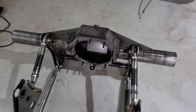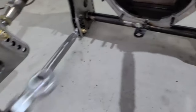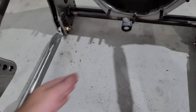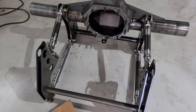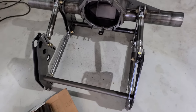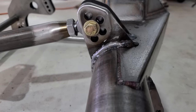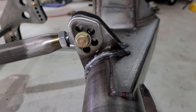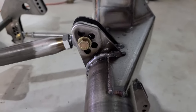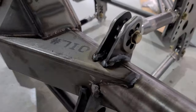How I've done the diff: I've welded the arms on. The way I've set it up for the wishbone is I'm going to have it under here, and the wishbone is basically going to triangulate — it's like a triangle section coming in here, that's going to support the housing from moving side to side. I won't be able to do that until I get it all mounted up in the car. I've only just MIG welded the four link brackets on the diff because I don't know how to TIG weld, and I don't really have the time to learn it. So I'm just going to stick with the MIG, and if I get any ugly welds I'll just grind them — as long as they penetrate and don't break off, I'm happy.